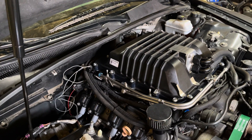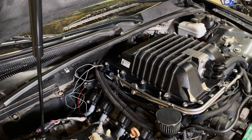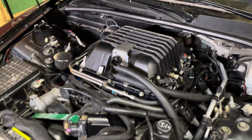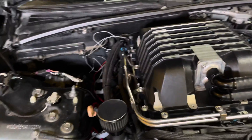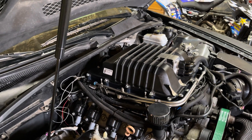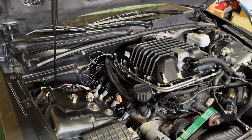I'll give you the torque specs and bolt pattern for the lid. The torque for the bolts is the same as the blower: 44 inch-pounds on the first pass and 89 inch-pounds on the second pass. When working it down with that thick black o-ring and new gasket, it needs to collapse down a little, so I like to take my time and work my way around it — I'll make three passes in the bolt pattern. I'll put up that bolt pattern graphic on screen.